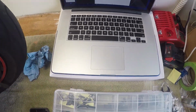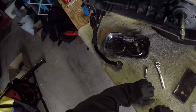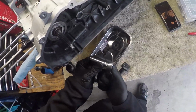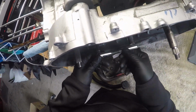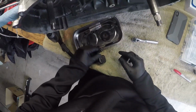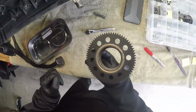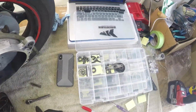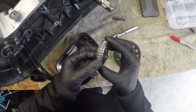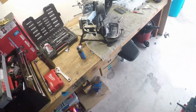All right. After that, number 5 is the starter wheel gear holder. And is that another 8? That's another 8 millimeter. And then the starter gear. And number 7 is the roller. Oh snap. Starter gear, put in a Ziploc bag. We're gonna reuse these, I think. The service manual does not say replace new.